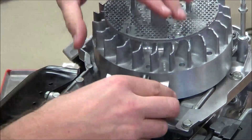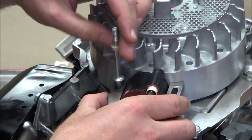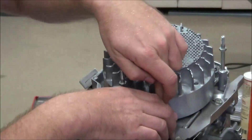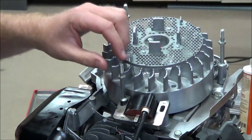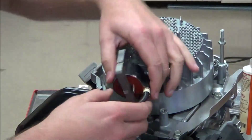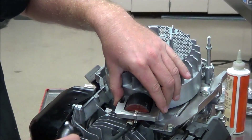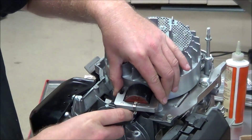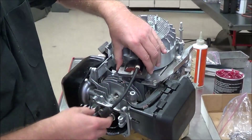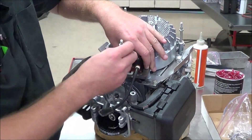To get the magnets out of the way, I'll go ahead and put the mounting bolts in place. This mounting bolt serves a dual purpose — it's actually part of the recoil. It's a pretty equal triangle, so if you accidentally put it in the wrong position, you'd bolt it down but then your fuel tank and recoil would be wrong. Also remember from our training module: mount the lead up. You could bend the wire the other way but you'd be stressing it like crazy. Going this direction, you can see how it naturally falls nicely toward where the spark plug would be.